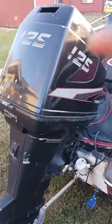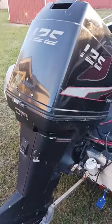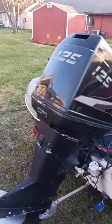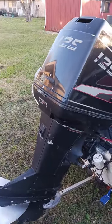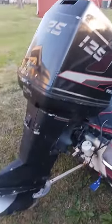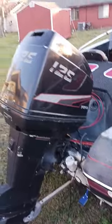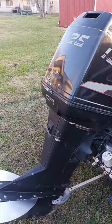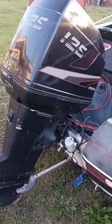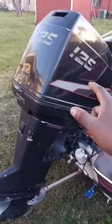And I noticed that my pickup I was pulling my boat with was also detonating at the same time that my boat motor had went out. So something was going on with the gas detonation. They weren't selling us good gas or something, because now my truck gets a good grade of gas and it's not doing that detonation no more. But during that time, the power head was gone, it lost compression in one of the cylinders. I ended up putting another motor on here.